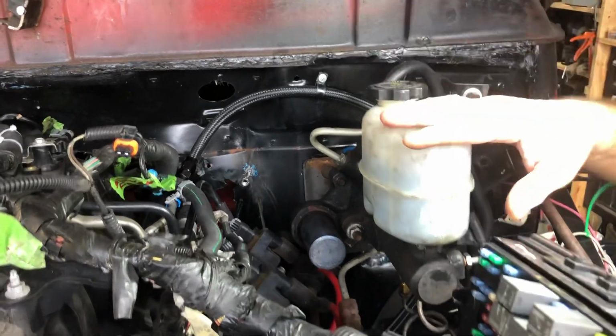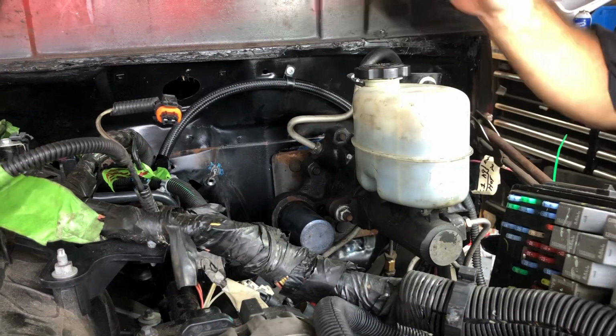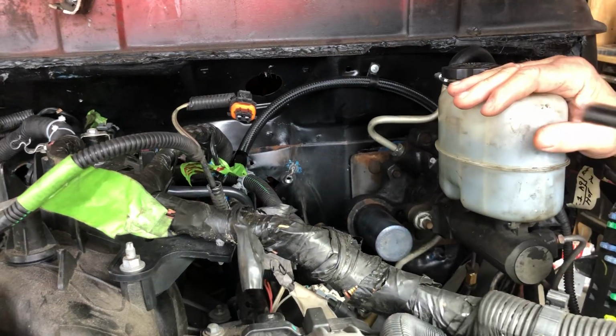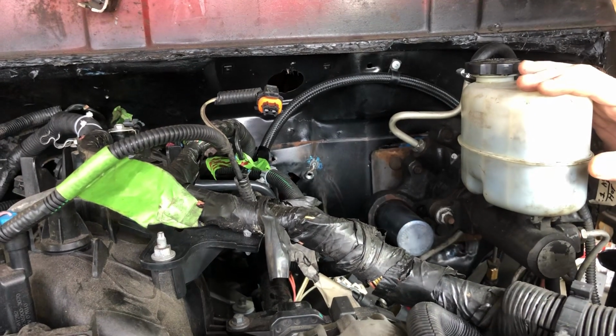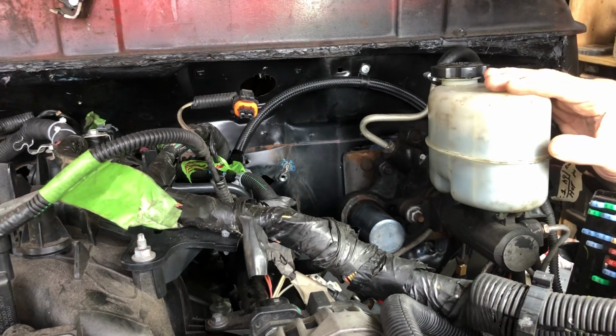I went with a Hydro Boost style brake system rather than the Camaro vacuum booster. This Cadillac Escalade had a Hydro Boost in it. It already had 2 returns on the power steering, so I just decided to go with that. No harm, no foul. The junkyard, believe it or not, returned the one I had, and I bought this one instead.